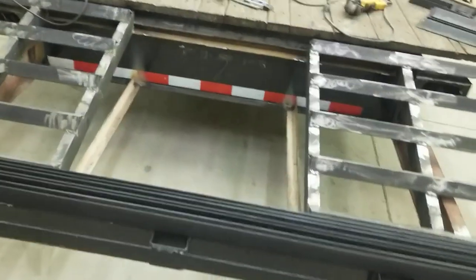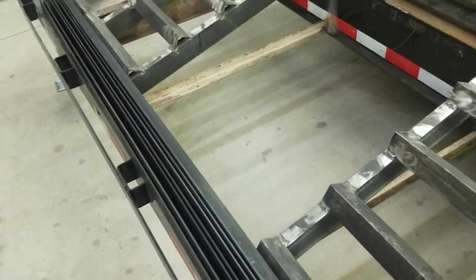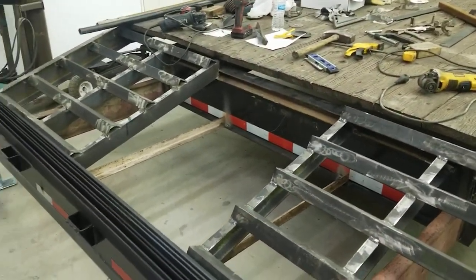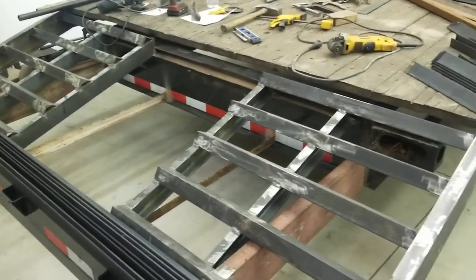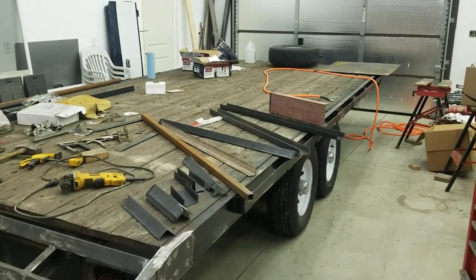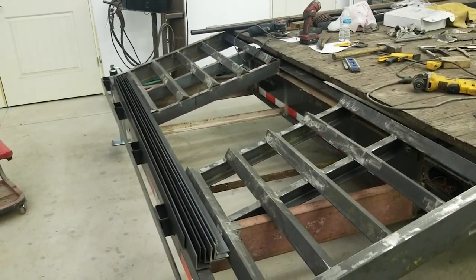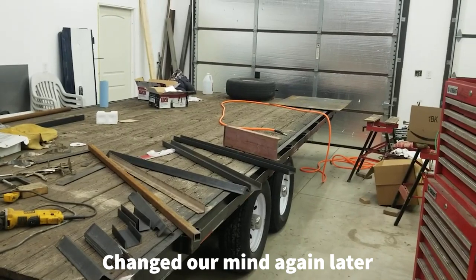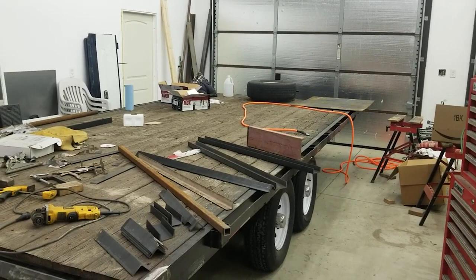Initially we were going to build a box here — you can see I put some bottom rails down there temporarily, they're just tacked in, I'll be removing those. We were going to put the spare tire in there, but number one, it doesn't really fit as well as we'd hoped. And also, we're starting to get a lot of weight on the rear of the trailer, so we decided we wanted to move some weight back up front. We'll be moving the spare tire back up front somewhere, and we'll also be adding a storage box up front where we'll keep all of our straps and things like that.